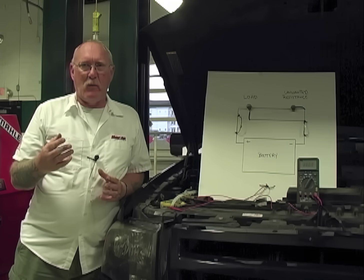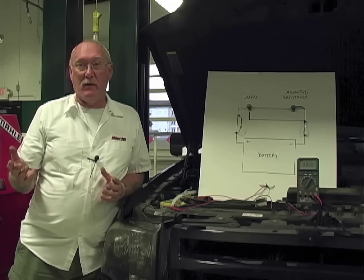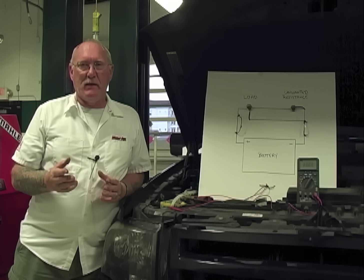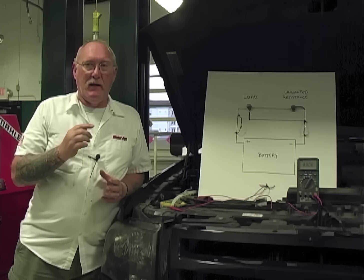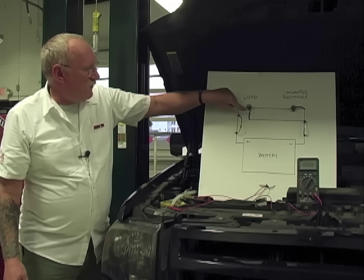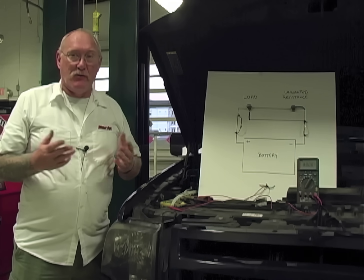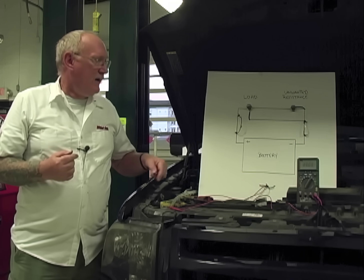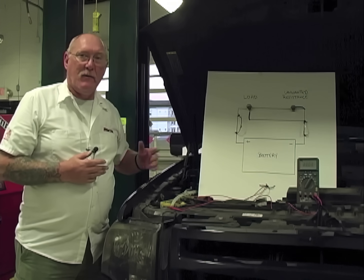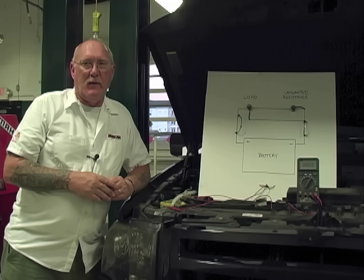If we know that voltage is supposed to drop once it crosses the load and drop to nothing, if we see anything other than that, it's a big red flag there's another source of resistance on the ground side we have to find. Let's go back and think about the measurements I took at the very beginning of this video. When I put my meter leads between the negative post and the chassis ground, I was measuring between the ground side of the load and the ground side of the battery — the same as you see here. Consider what's feeding on that chassis ground — there are a lot of circuits. So as a troubleshooter, I'm going to look at what's between where I'm at and where the negative battery post is — in this case, the cabling running from the body back to the battery. If it were something on an individual circuit, look for things unique to that circuit to help you isolate where to test.